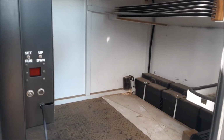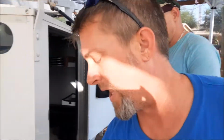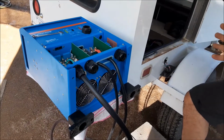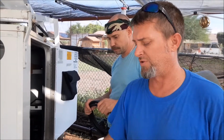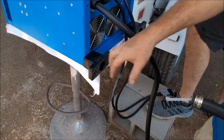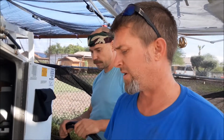And that is going in this spot. Soon we'll show you the battery box with it. Let's talk about the isolators real quick. These little blocks at the bottom are isolators. Being that this is a single axle trailer, it's going to be bouncing down the road, and we assume it's going to be jarred around. So we want to protect the inverter as much as possible. On this build we chose shock absorbing isolators bolted to the floor, so that the inverter can move around without being jarred beyond a G-force that we don't think is good.